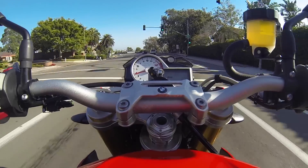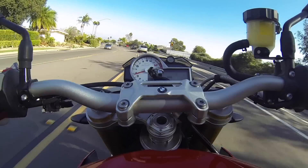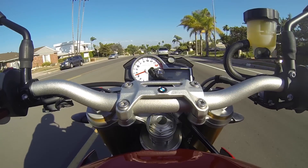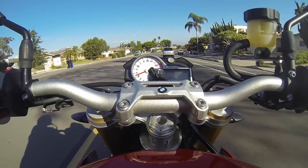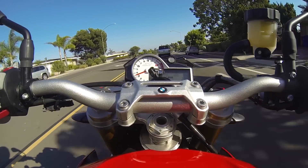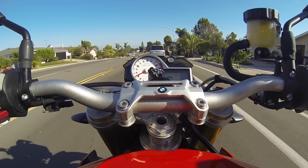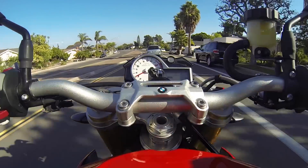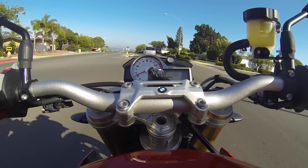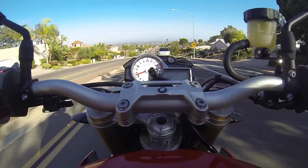For guys who are racers or coming off a sport bike that frequently tracks, this is quite a change. As you're used to a bike where everything is predictable — you know what it's going to do at 50%, 75%, or 100% braking, under second gear at high revs, full throttle, how much brake dive you'll get — those are things you learn through muscle memory. On this bike it's different, because depending on where you are, the suspension's changing even mid-corner, and it takes time to get used to that.